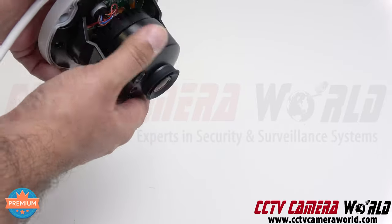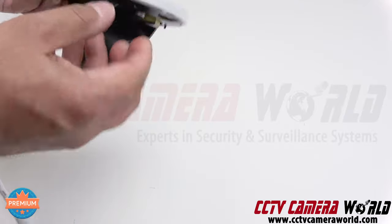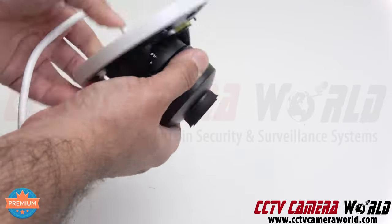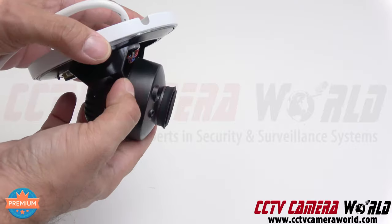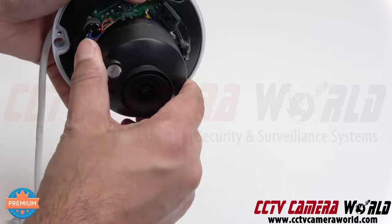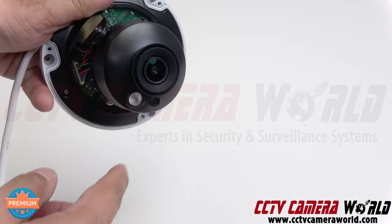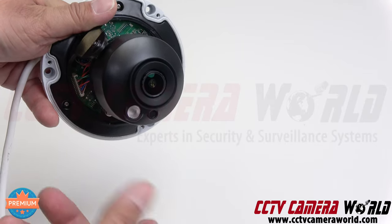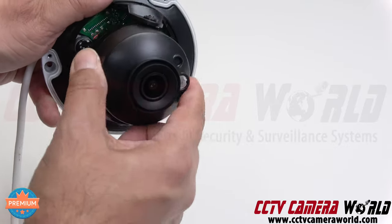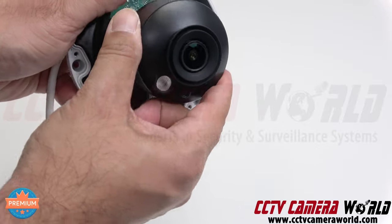You can have the camera look straight down, or change it over to the other side — that's perfectly fine as long as you're not cutting the wires. The camera assembly also swivels. If you mounted the camera in the incorrect direction and your picture is upside down, you can rotate the picture by rotating the assembly, which moves independently to let you adjust the angle of view.